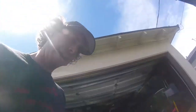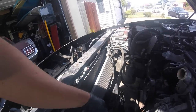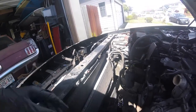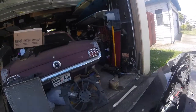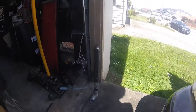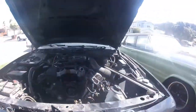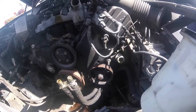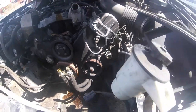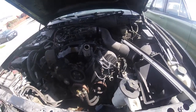That half is done. One of the cool things you can probably see here is that these police interceptors came with an engine oil cooler. I took the bottom half out of that — it kind of goes right in the middle of the lower radiator pipe. I'm gonna swap that into the new car. The second part I'll have to go under the car, and I'm not doing that today — there are a few other things I need to do when I'm down there. But I'm gonna put this in the new car so it is oil cooler ready.